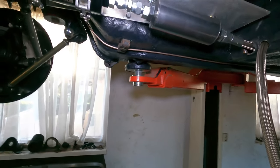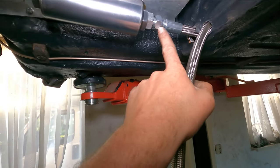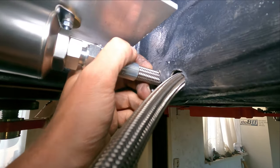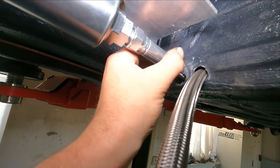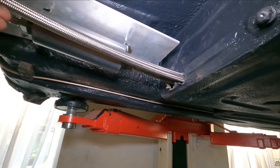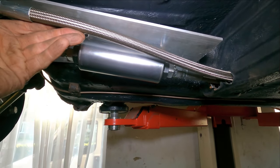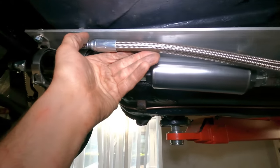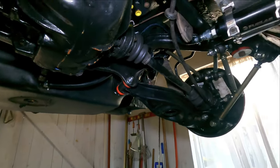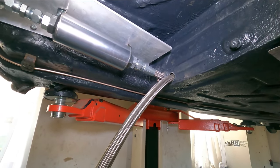Let me show you in the car. Fuel pump, filter, and the hose connection. In the beginning I had a double hose connection here, now it is just a single one - this just needs to be tightened. It is moving freely and not really touching the top. I will seal this completely afterwards. The length that I need in the car I can just pull - I have another half a meter. This will be tightened at the best angle with some mounting blocks. Then I can feed the same hose diameter and it will go over the subframe to the back. I am going to finish off the hose in the car so it is all nice and tight.